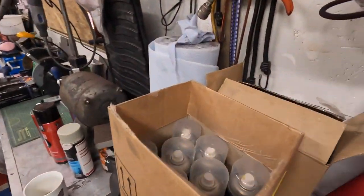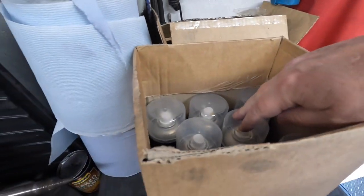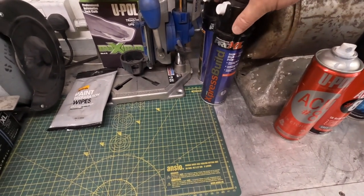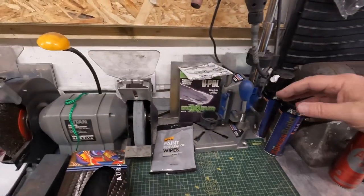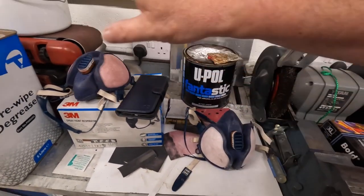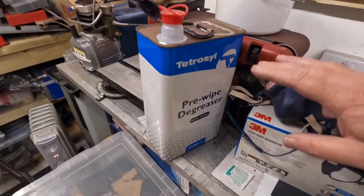We went to get some paints. This is the paint — it's the RAL 3005 Wine Red. I've got the clears as well — six cans of clear, eight cans of base coat. I've got a feeling I haven't ordered enough high build. This is red high build primer, which is pretty good. I've done some parts with it with one can, I've got two left and I've got to do the mudguard yet, which is out there in grey primer. I might give it a coat of the red anyway because it's high build and it gives me a bit of tolerance for rubbing down. I've got some masks — I keep alternating those, wear one and then the other. I've got the panel wipe, a full tin I hadn't opened — had it years, just a bit of rust on top but she's still a full can.